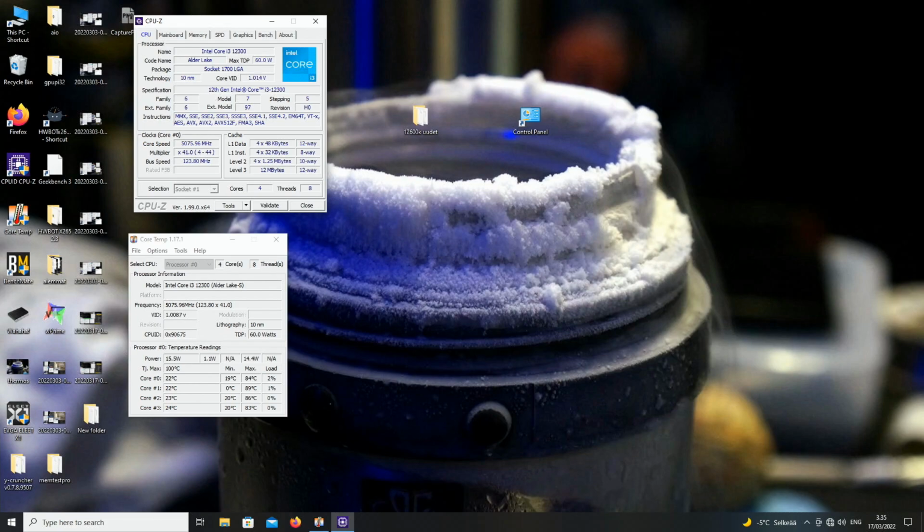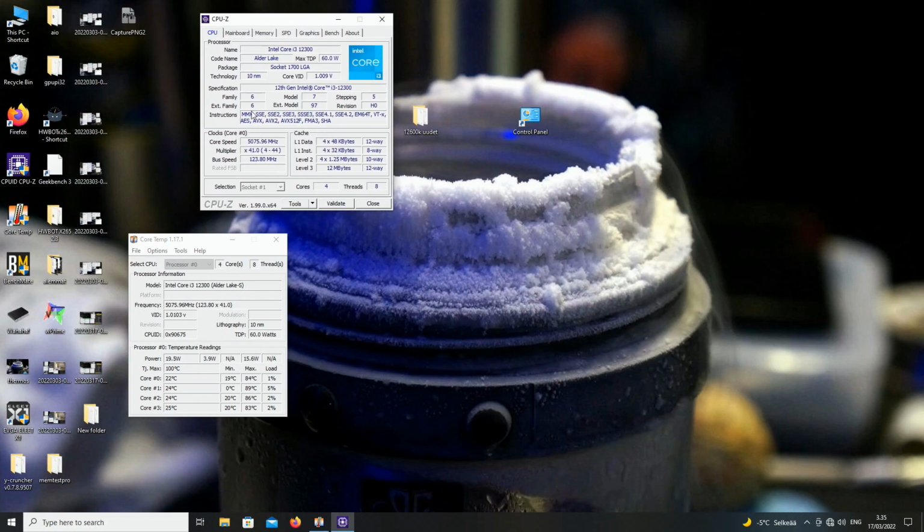But this is pretty good. So pretty happy with this end result. So the cache is pretty wicked, and the core up to 5.35 at 1.375 on water cooling. So that's definitely a good result. Many people were running just 5.5 GHz or 5.6 GHz on LN2, and I'm actually quite close on 5.4 on water. So I think that's pretty interesting. So I definitely look forward to testing this CPU on LN2. Stay tuned for it. It will be coming on my channel somewhere in the very near future.